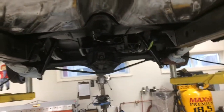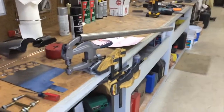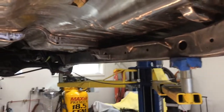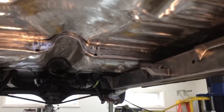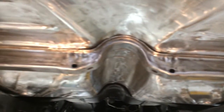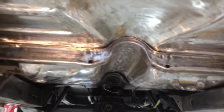Right now I've got probably two and a half hours in this section. Doing more of the same, trying to get this underfloor stuff ready — spent a little time here yesterday and a little time the day before. This is prepared now, finally. I got all the old paint and stuff that was on there off. Once I clean this with a degreaser — wax and oil remover — it's ready for primer, ready to start painting. I did the wire wheel and followed that up with a Scotch-Brite scuff pad. You can see the tooth it left, which I'm happy with.